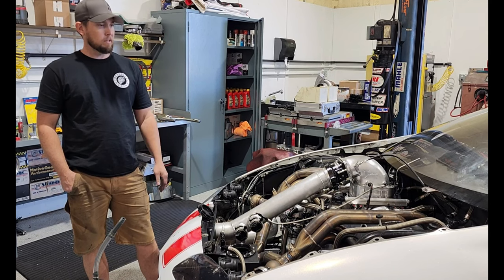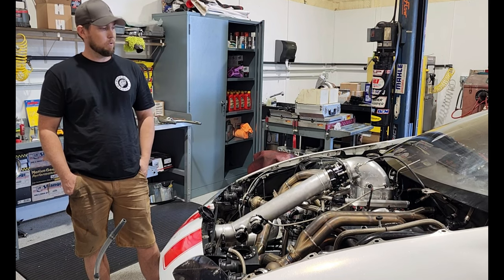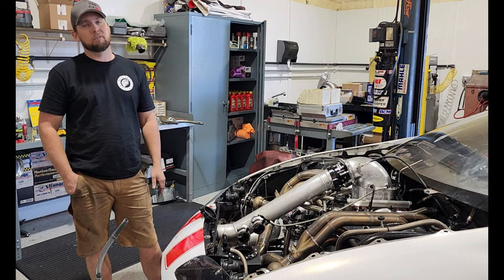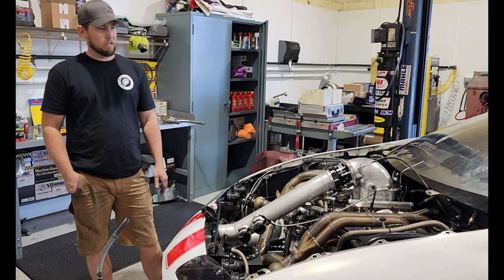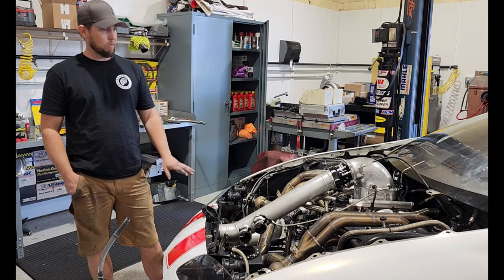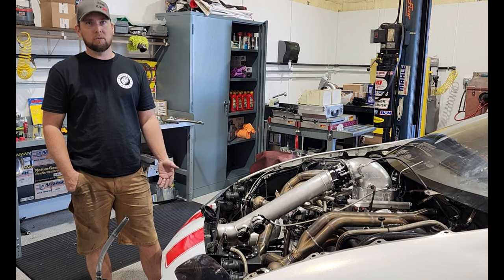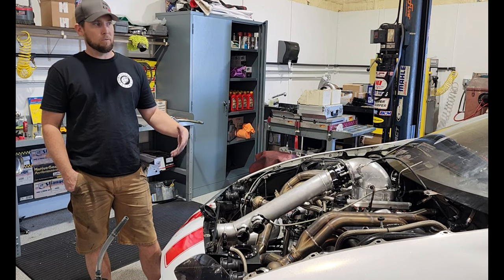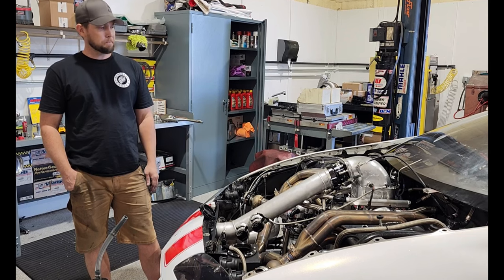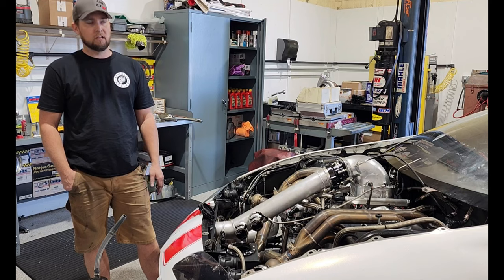We ended up having a lot of weird, crazy issues, stuff we'd never seen before. Had an issue with the way the pistons were made, which was just a mistake from the manufacturer. And of course, they got us straightened out super quick. We've had pistons for this engine kind of all year. But again, the LT1 was back in the car. We did get our 30 over pistons, and we just put it back in. We had new heads ordered for this that we didn't have yet, some of those kinds of things.